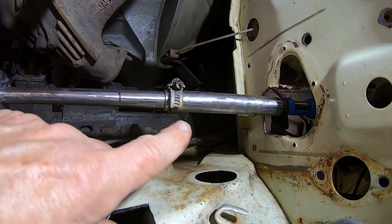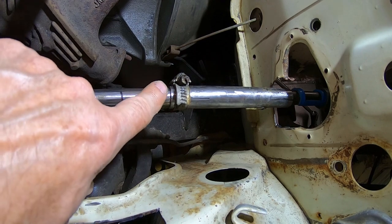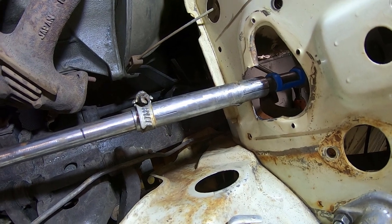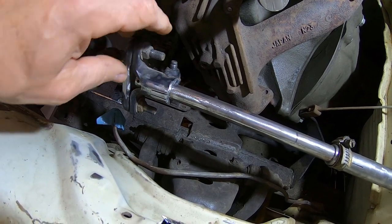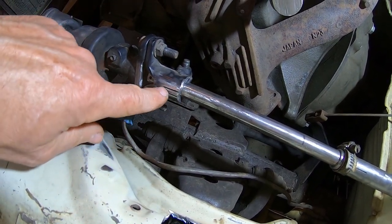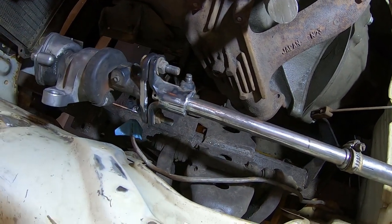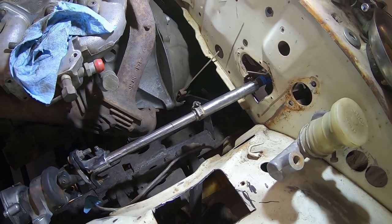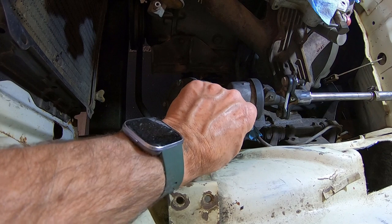So I did this on the steering column and it worked, I think. So we're going to do it again. I'm going to put a little tack on here and then move the hose clamp to that end. Tack the one on the inside, and I'll take the whole thing off and weld it. Haven't even welded this one yet. Oh, I did the same thing here. This column adapter, this shaft was too small, so I had to slot it. I actually had to remove some of the material on the clamp so that it would squeeze down tight. So that's nice and tight and straight now. So once I weld these two, the steering in theory should work. I put the steering wheel on. Of course, I still got to build the mount to hold this.